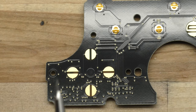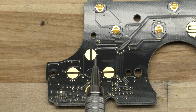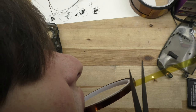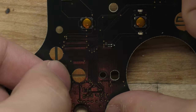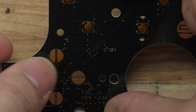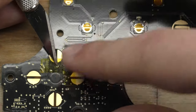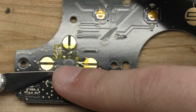The reason we get so many missed inputs is because these contacts go a little bit lower than they need to, so sometimes the very inside edge of a contact will register when going from one direction to another. So what we're going to do is take some tape — I used Kapton tape when shooting this, but I found out later that clear scotch tape actually works way better, so I'd recommend using that. We're just going to take a tiny little piece of it and tape it over the inside edge of each contact. You can go ahead and tape it about halfway up each contact. When filming this, I went about a third of the way up and found it wasn't quite enough. Just don't go too far though, because then you won't be able to register any input at all.